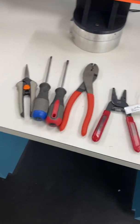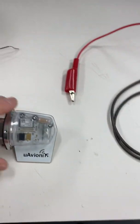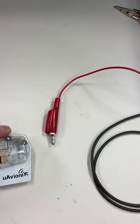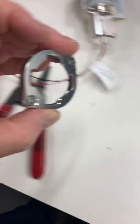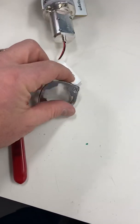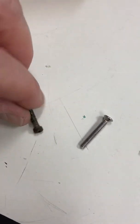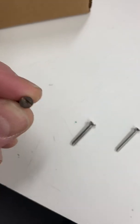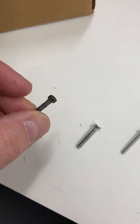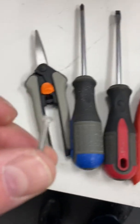I did run into a couple of problems with the installation. The first one being the mounting plate. It comes off like this, and the first problem was that the mounting plate screws were the wrong size for my airplane. This is the screw that came out of the airplane — it has a square head and it's a number six screw. This is the screw that came with the tail beacon — it's a number four screw, so I had to go to a larger screw.